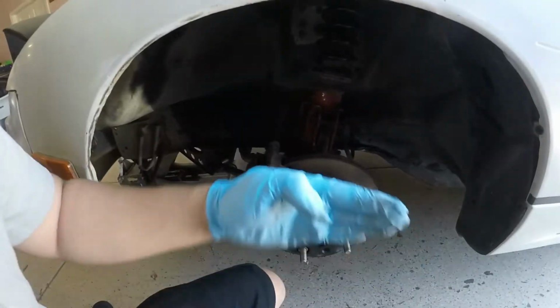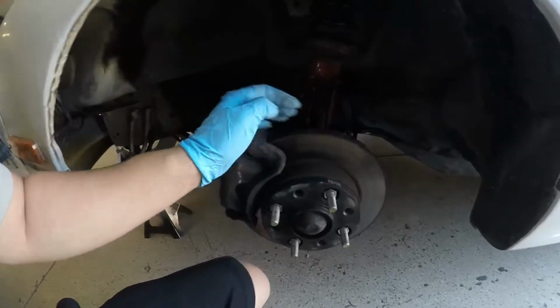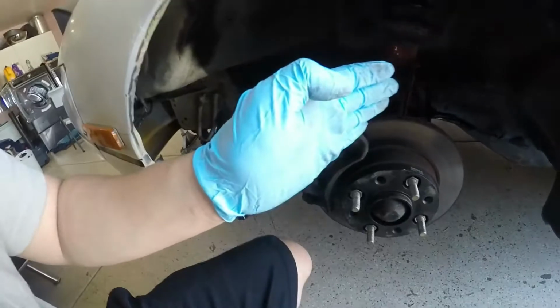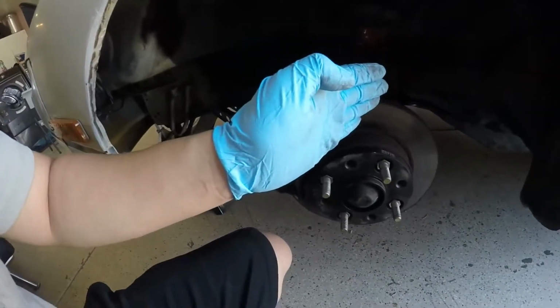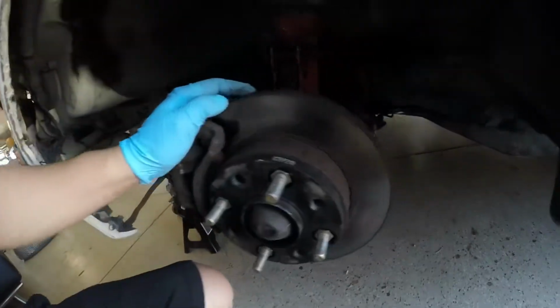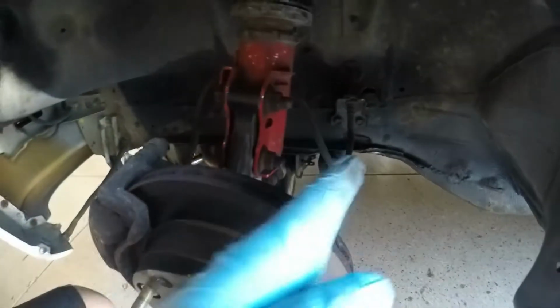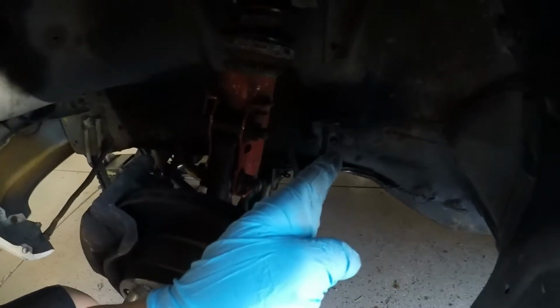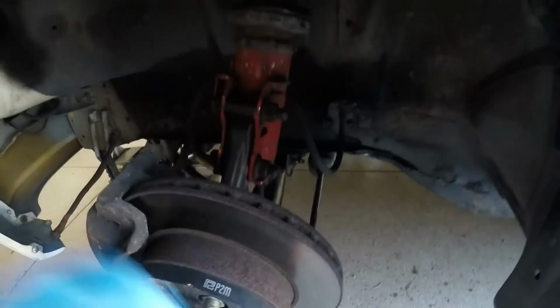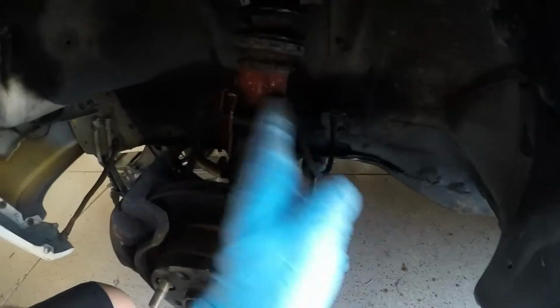You'll go about your normal steering geometry, and then because it's a short knuckle, once you pass your normal steering limit, the tire wants to swing. The tire, by itself, pulls itself harder. It gives you a heavy feel. So if you can see, the tie rod is pointing aft, or back of the car. We're trying to level it, or if you can, move it forward.